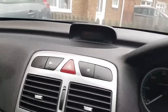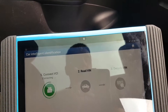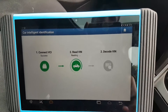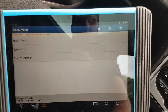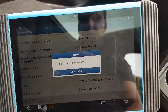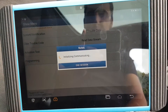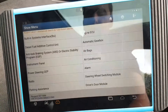Here we go - it's in economy mode, that's in Portuguese. It will come out of economy mode as soon as we start the engine. The auto scan failed so I had to come through manually. This video in the end should not be much more than a key programming, which I'm going to try using the Artipad from start to finish. Okay, so we are in the BSI right now - it's going to read the trouble codes. Surely there will be immobiliser stuff - but no trouble codes found. That's interesting. Let's go to the engine ECU.